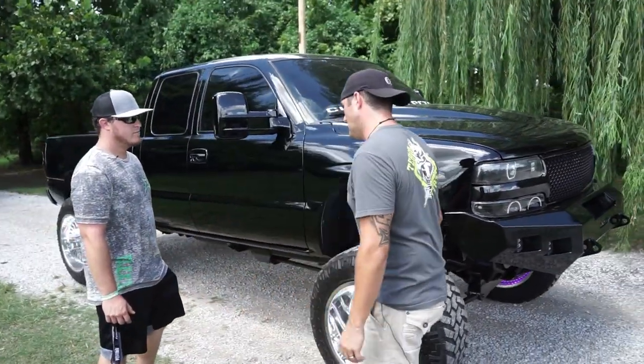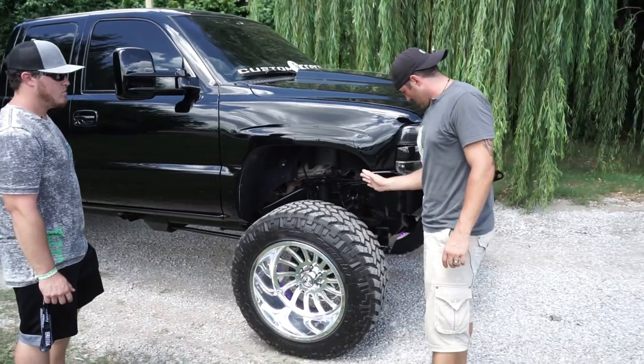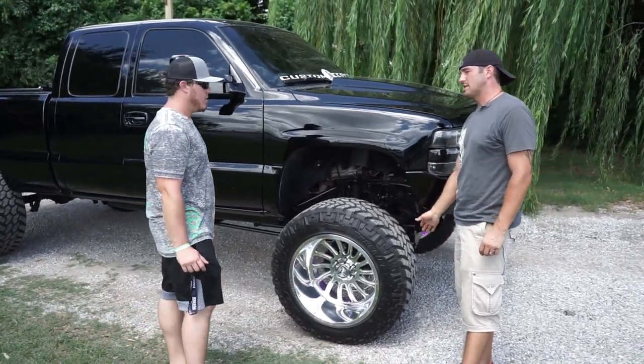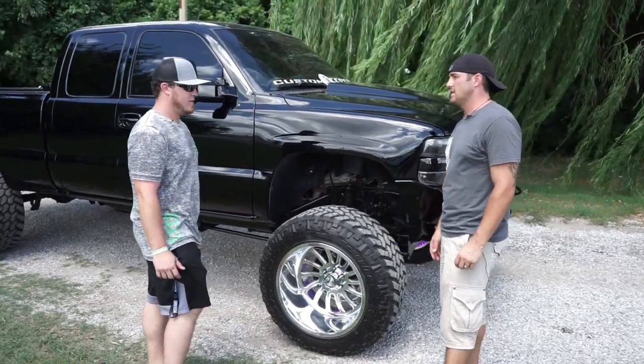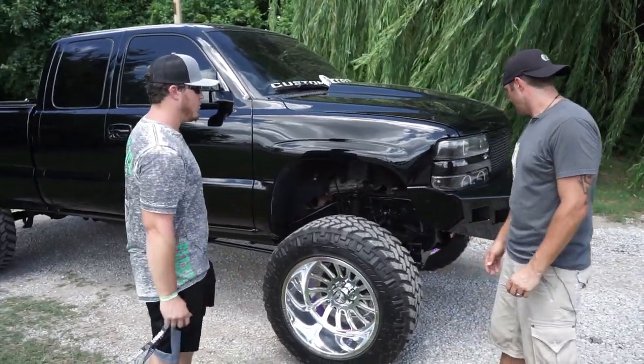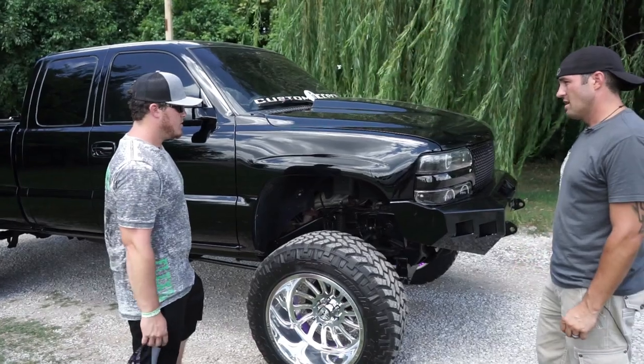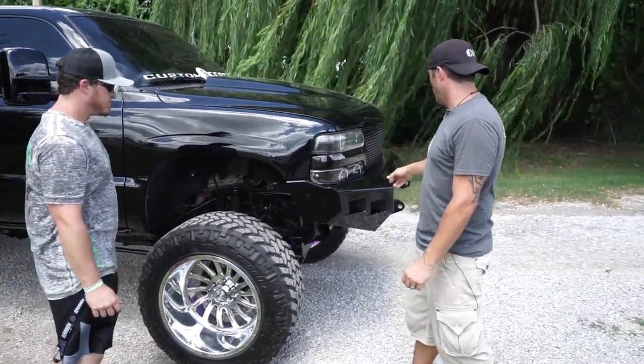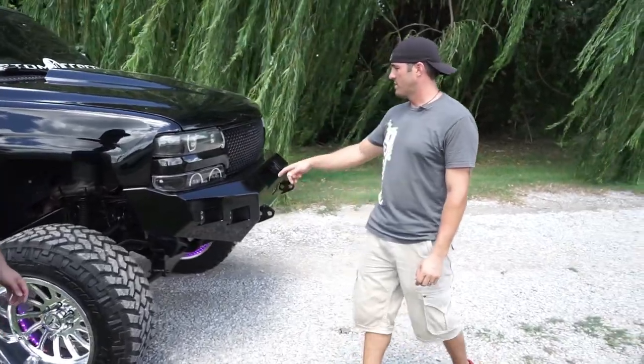So that's a six-inch plus two-inch body plus almost twelve inches of lift with a 37 — and no trimming? None. Did you have this on with the factory bumper? No. I'd be curious if you'd have to trim. You would have to trim the front plastic — it would get into just the valence, but zero metal trimming. And then he's got the Move front bumper. Check out the front — he's got completely custom headlights.